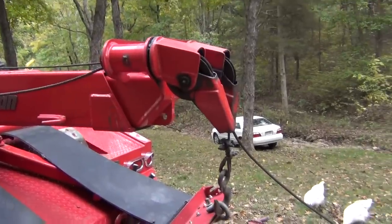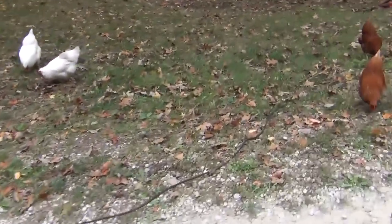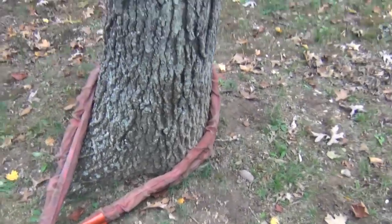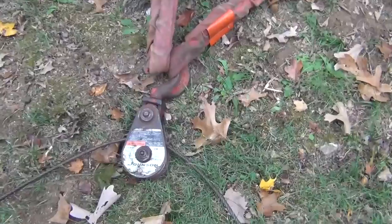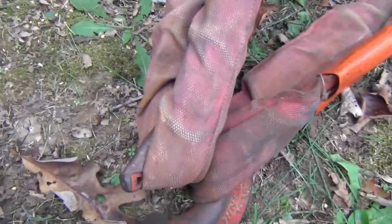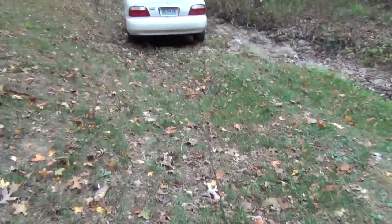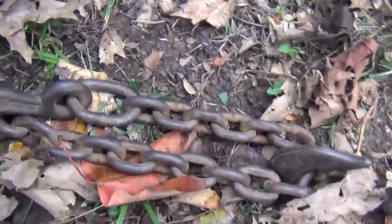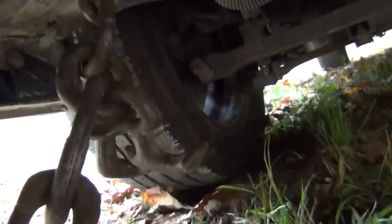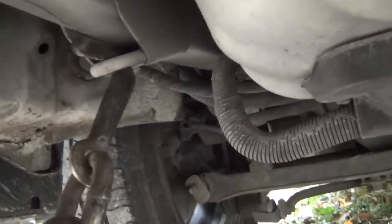So we're coming from our truck with cable all the way down to this tree, where there is a snatch block hooked to a continuous loop which is looped around a really sturdy tree. You've got to make sure that loop is all the way in the snatch block hook. The cable goes all the way down to where the car is, with our recovery chain grab-hooked back into itself and then hooked onto the car.